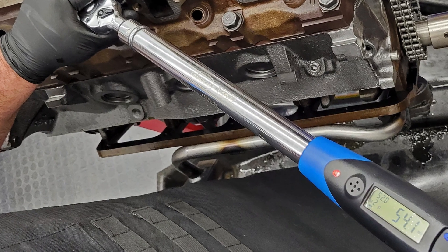A good mechanic at the shop or dealership will remove the valve cover, use a specific torque wrench to measure the tightening force, check all the bolts in about 15 minutes, and then provide their assessment. It's worth noting that in most cases, when car owners complain about potentially under-tightened cylinder head bolts, it turns out to be a different problem. Diagnostic testing will clarify what exactly is causing issues in the engine, and unfortunately, without the right tools in your home garage, you won't be able to check and fix this problem on your own.